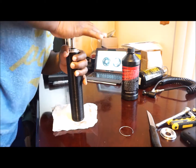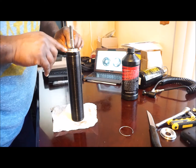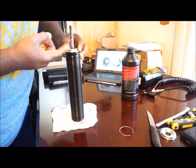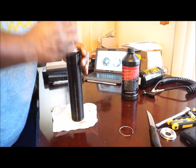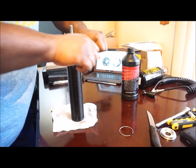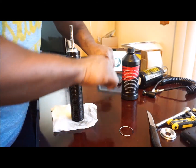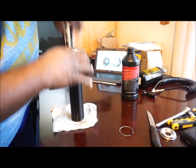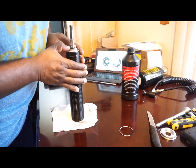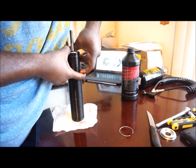You don't want to push past the shaft, because if you do, this little C-ring here is going to embed itself halfway inside the wiper seal piston, and it's a pain — you're going to have to take everything out because it's going to get stuck. You'd have to hold it by the wiper seal and yank on it to try and free it out of the wiper seal. That's why you don't want to push past the shaft. You want to push by the seal on the BC Racing BR coilover.